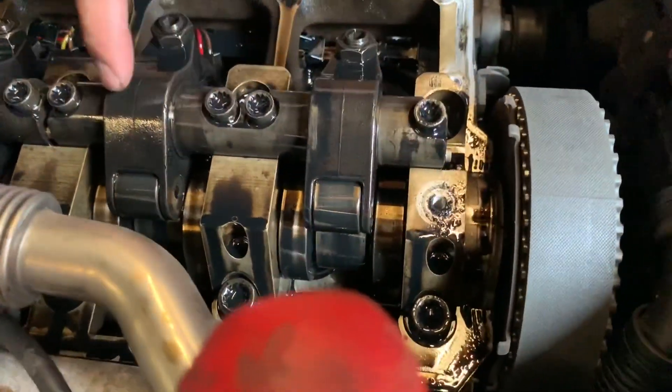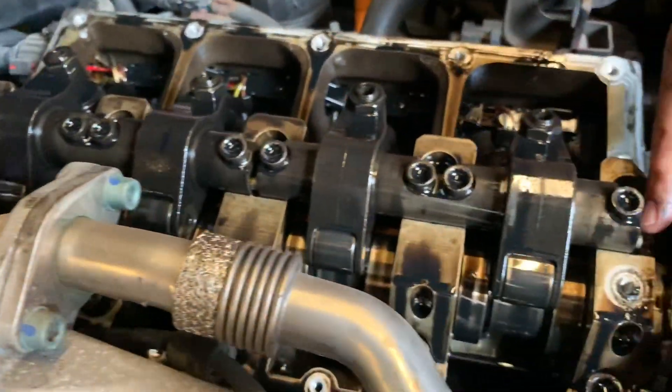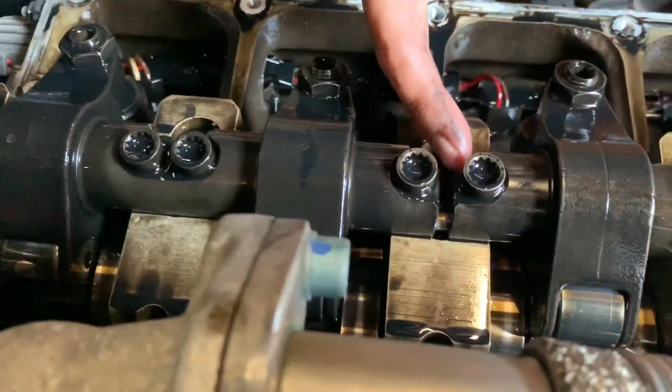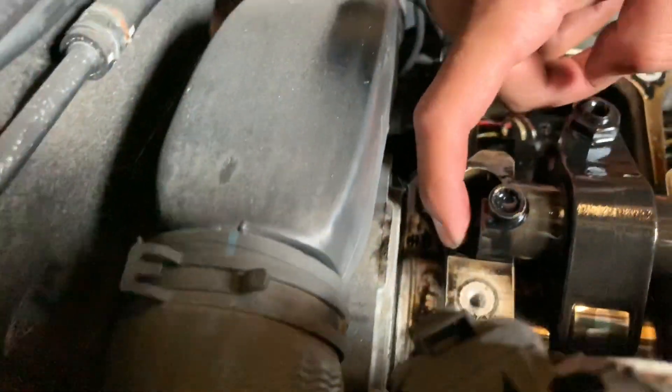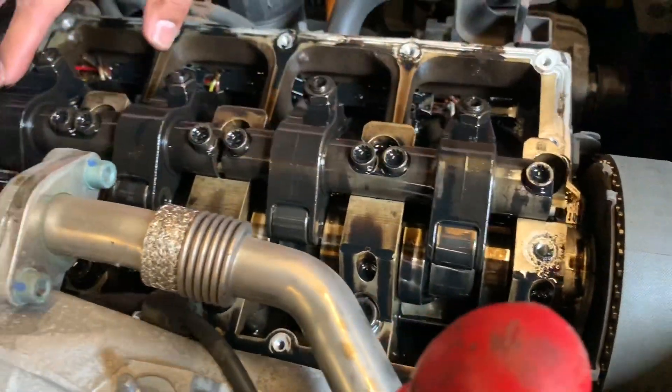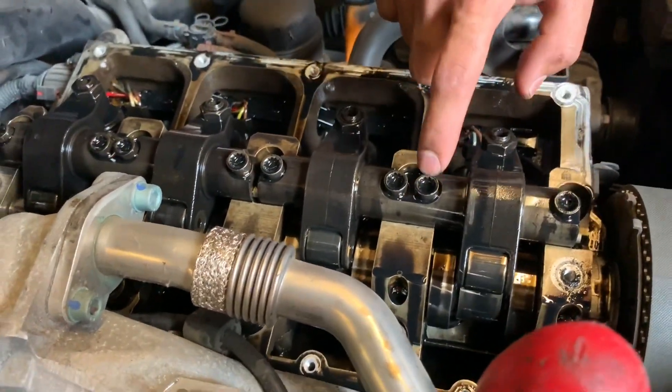So what you'll see - these are your injector rockers. You'll see this lead plug has actually come out halfway. The one in the middle here has come out as well, all the way. And it looks like the one on the end is still in position, but once we get the rockers off we'll have a look. So mark your rockers, and then remove these bolts.